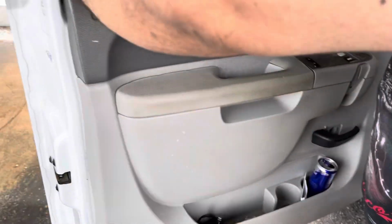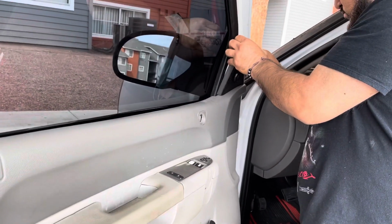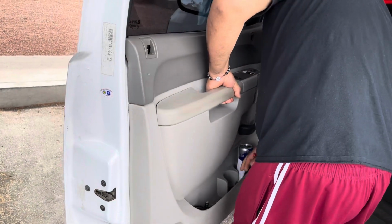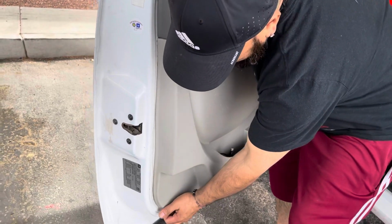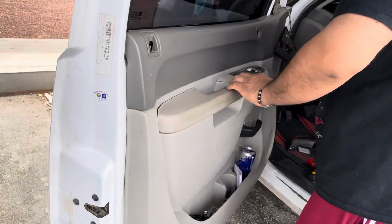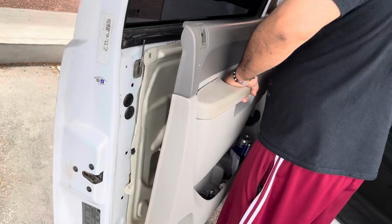So the clip is out. Now we gotta remove the lock switch. There's a trim piece at the corner. And just push up. There were 2 more screws behind there, and now it should come out. Yep,